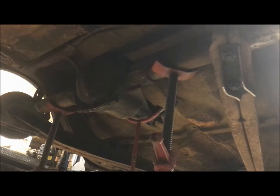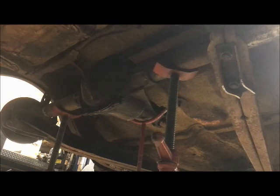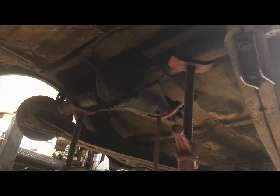So I'm going to take this axle out, put the G-body 373 Posi up in there and mock it up, and then we'll get into pinion angle and the spring mounts and that kind of stuff. The only real difference between them is this G-body rear obviously does not have disc brakes on it. Don't care, drum brakes are just fine, and that's just the way it'll be. So let me get that G-body rear into the garage, and I'll put it up against this one. You can see how much difference there is in width.